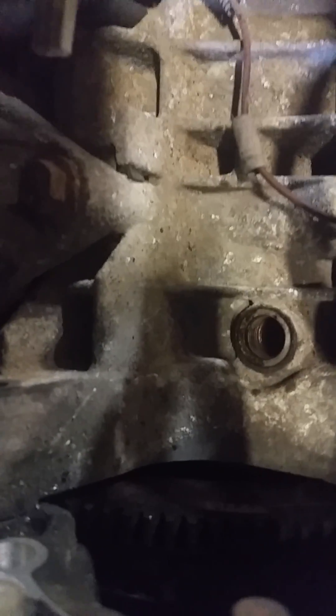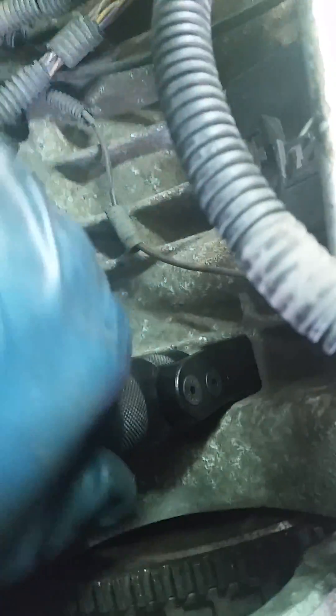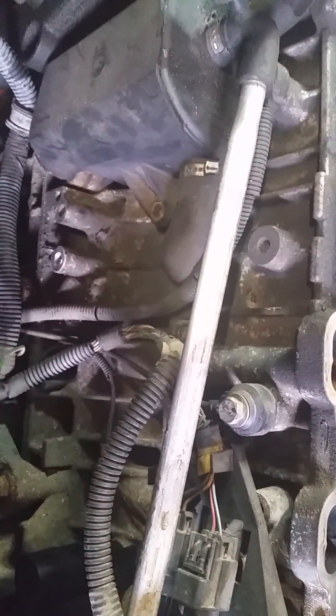You're going to turn the crank counterclockwise, and what's going to happen is this slides in and it's going to start riding on something. I'm not 100% sure — I'm a Suzuki person, not a Volvo person 100% — but then it'll get to a point and it'll just lock into place. This does align perfectly with the hash marks that are on the oil pump and on the timing sprocket.